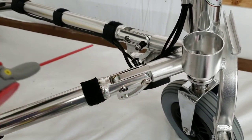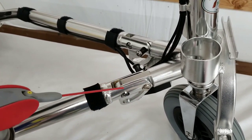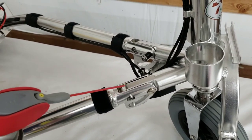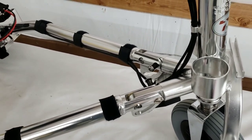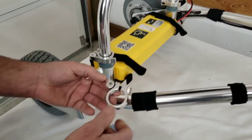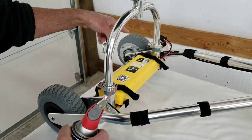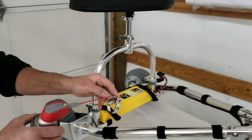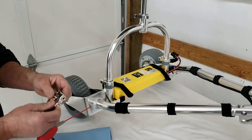You want to douse the locking pins pretty liberally. Throw a towel underneath your scooter or do it outside. You can also lubricate the actual hinge bolt. There are two brass sections in there that don't strictly require lubrication, but it doesn't hurt to get that stuff in there — it helps rinse out road dirt. We also suggest lubricating the area of your lever clamps from time to time. They're located, depending on your model, either on the right side or both sides of the yoke. Getting a little lubricant into the steering column from time to time makes things operate smoother and removes dirt deposits you might pick up over time.